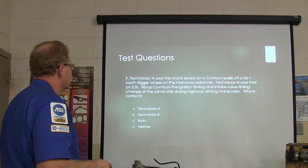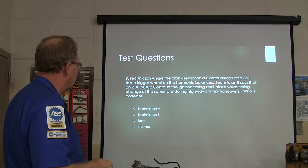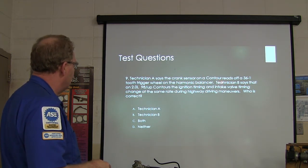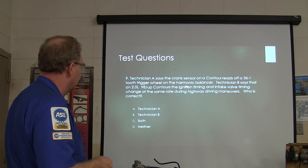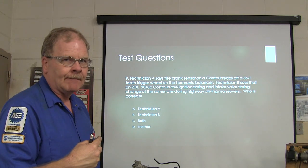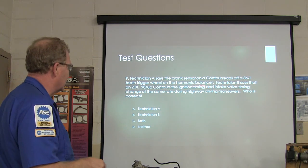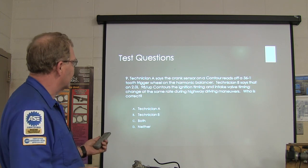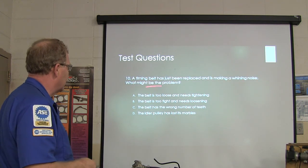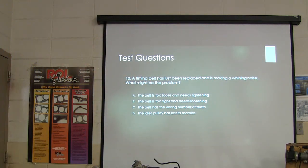This one right here is going to be, wait a minute, how did I do that? This guy right here is wrong. That guy's wrong. Where is that 36-minus-1 on this one? Remember? Yeah, flywheel. Flywheel, that's right. All right, Technician B says, and B is the right answer on that one, I believe. All right, a timing belt has just been replaced, making a whining noise. It's too tight. The problem is on that. All right, so what do y'all think?